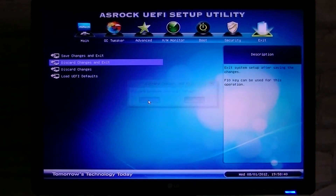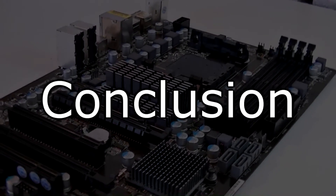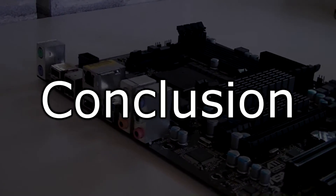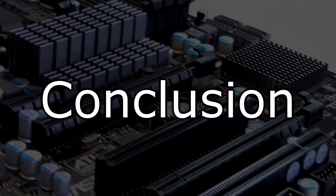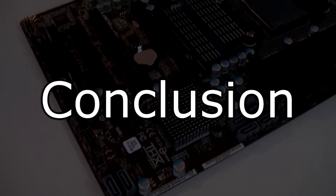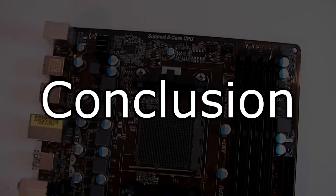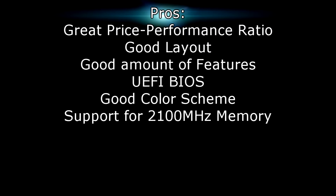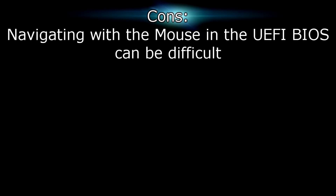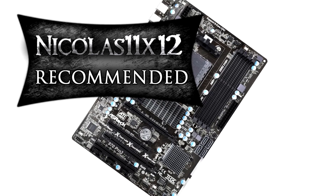I'll just discard the changes and exit. The ASRock 970 Pro 3 motherboard is a great choice if you're on a tight budget and still want good features and a good looking motherboard. It uses the AMD 970 chipset, which is lower than the 990FX chipset, so it's not the best choice for 8-core processors — the hypertransport will only allow up to 4.8 GT/s. But for quad cores, maybe even 6 cores, no problem. Overall this ASRock motherboard offers great features and performance for the price. Pros: great price-performance ratio, good layout, a good amount of features, UEFI BIOS, a good color scheme, and memory support up to 2100 MHz. The only con is that navigating with the mouse in the UEFI BIOS can be difficult. Other than that, I give this motherboard a 9 out of 10 and definitely recommend it. Thanks for watching and don't forget to subscribe!